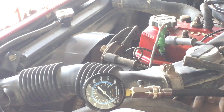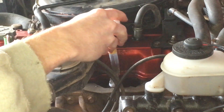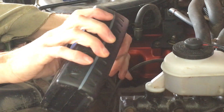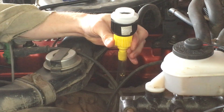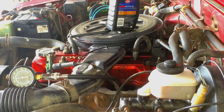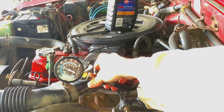First, I recheck cylinder number 2 the same way I did before, just to be sure I cranked the engine enough — still the same 153 psi. On to the wet compression test. I'm adding a small amount of oil to the cylinder, just about a cap full from a quart sized bottle. The oil creeps around the perimeter of the cylinder where it contacts the piston rings. The viscosity of the oil allows it to fill in any tiny gaps between the rings and cylinder where pressure could be escaping. After giving the oil a minute to make its way around the cylinder, the wet test on cylinder number 2 gave me about 177 psi, which tells me that the tolerance between the piston rings and the cylinder wall is the culprit.